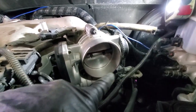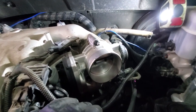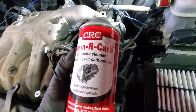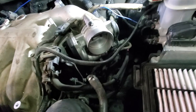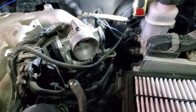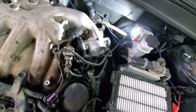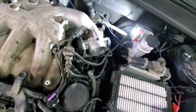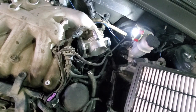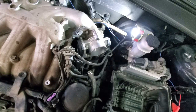As I mentioned, I cleaned the throttle body while we had good access — for that I used CRC Carb Cleaner, a really awesome product. One thing to consider: have a face mask on since it's quite nasty stuff — you don't want to breathe it in. Next put the air filter housing back. Since this is the clean side, take an air compressor and blow everything out of it just in case something fell in.